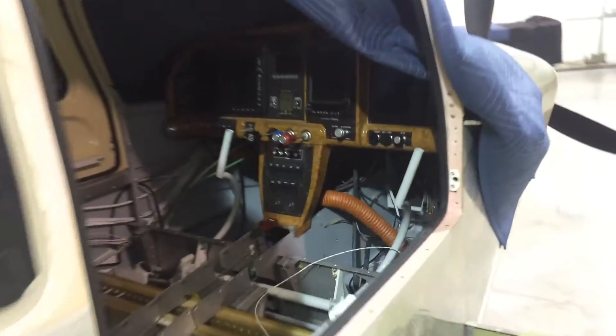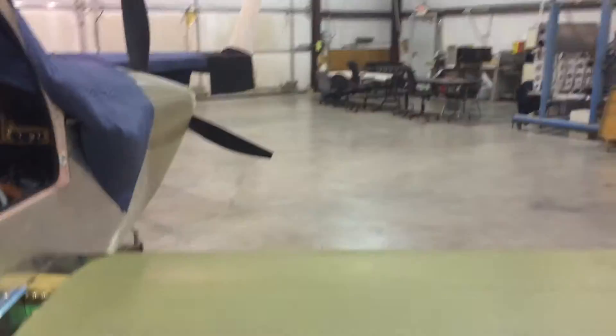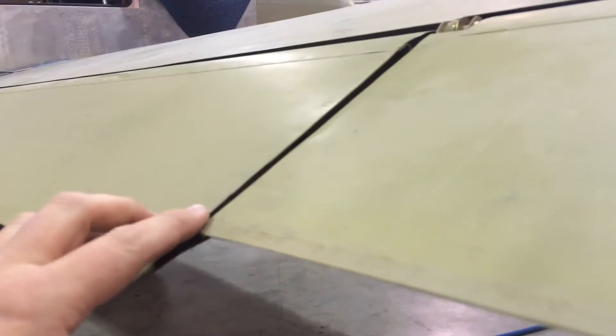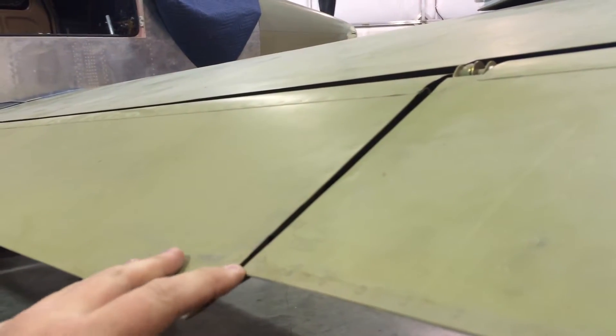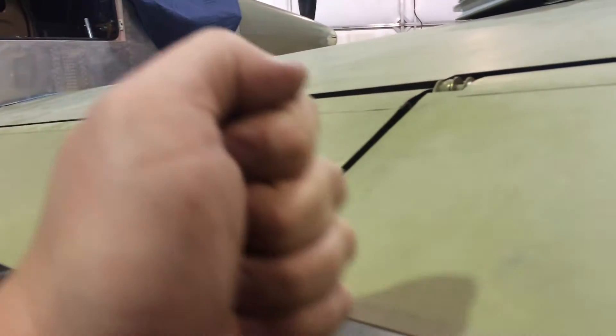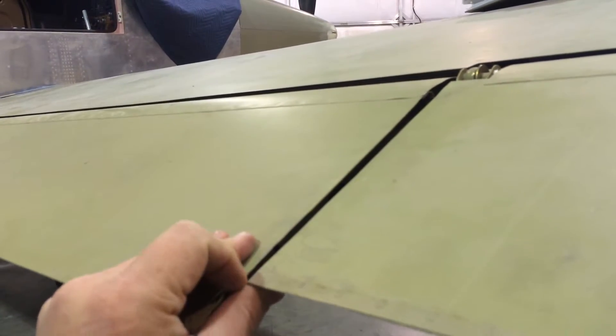My sticks are all off here to the left. If I shoved them back over — we're in a full right roll or left roll. My right aileron: I shoved that thing all the way over, pushed this aileron down flush, down flat. And you can see that I ran my flap on my flap motor down so that this is at full deflection. It sticks all the way over to the left — full deflection.